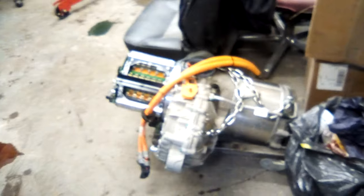I do understand — because I not only work with mechanics, electronics and electrics, but I also do software for businesses. And I understand sometimes you've just got to go with what you've got, because you've got to get it out the door and make money. That's why they did the IGBT array as well — they really should have used modular units. I priced this up: right now, to do the same thing using IGBT modules instead of independent discretes is about twice as much. That array, if I can take it apart — which is another project — you're talking about £500 for IGBTs. To do it in modules would cost twice as much, about £1,000.